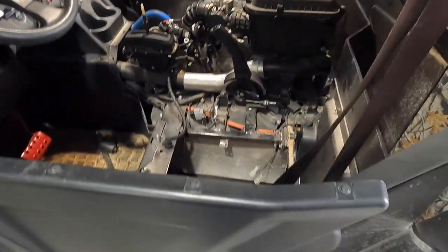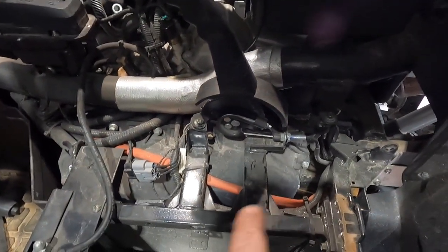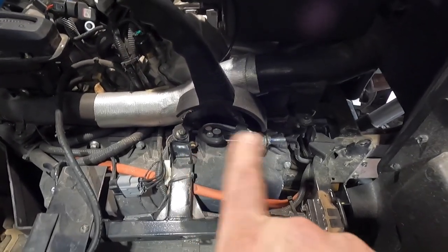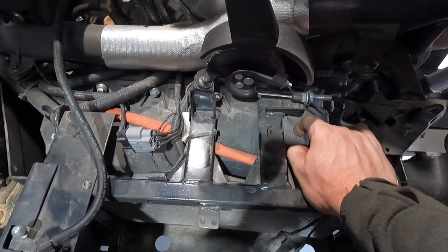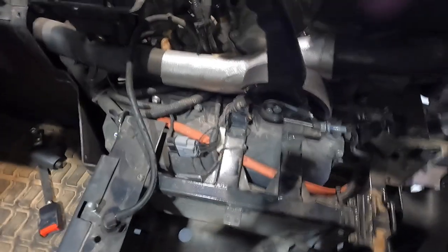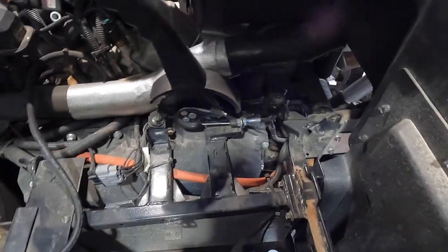The 2017 was the biggest culprit: on one of the pinion gears in the transmission it would rub against the sidewall of the transmission housing, back a nut off, and push a hole through it into your CVT cover. I've actually seen parts of that make the clutch explode into pieces and blow the clutch out through the cover or out underneath the seat — crazy things. In 2018 they were supposed to address that by milling it a little bit deeper.